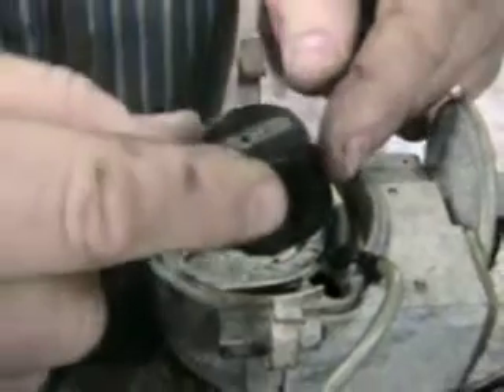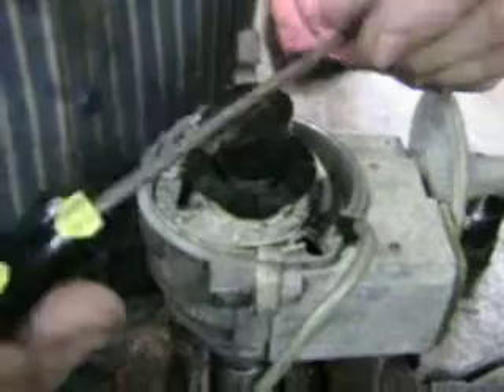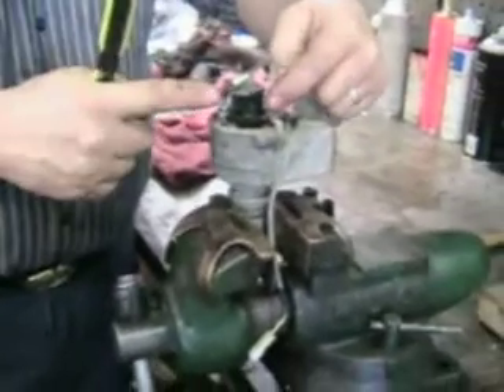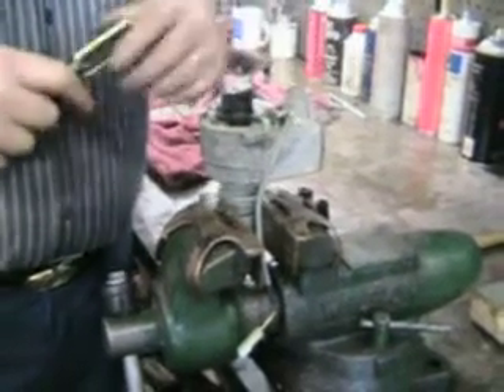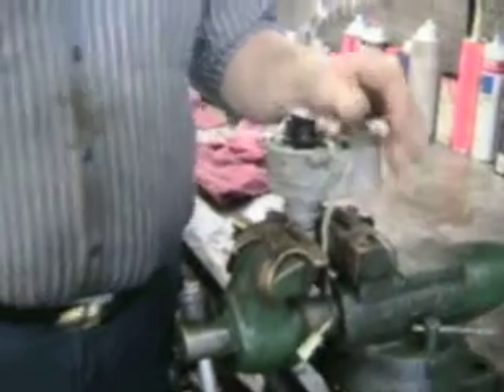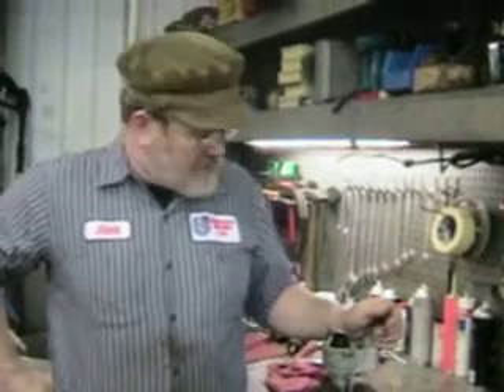This is probably pretty good and will work just fine. The point is that with this style of ignition — with this long, adjustable bracket — this isn't the case with the Pertronix; you don't have the option of adjustment on the Pertronix. But on the Allisons, and later on the Cranes, you can get them positioned in such a way that when the spark comes up to the rotor you've got a pickup on the cap on either side, and sometimes you'll lose your spark at high speed. If that is the case, this may be one of the reasons. For those of you with the Allison ignitions — that's A-L-L-I-S-O-N — we'll look forward to seeing you to adjust a carburetor.